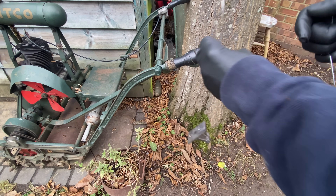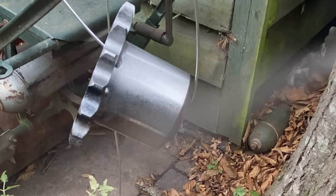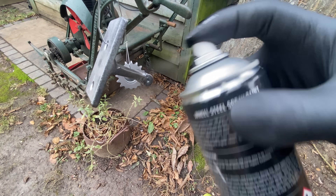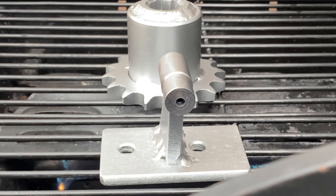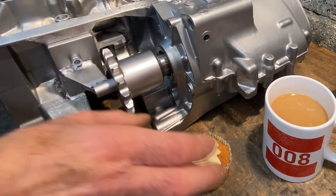I take it out in the garden and give it a nice coat of silver spray. I've finished spraying the parts but it's really cold today, so I take the parts down to my barbecue that I sometimes use as a low-bake oven. After just five minutes at 110 degrees the paint is dry and hard and okay to pick up, so I assemble the parts back onto the engine and it's done — just in time for a nice cup of tea and a cupcake.